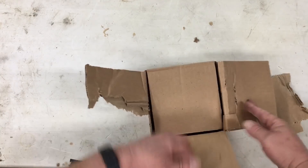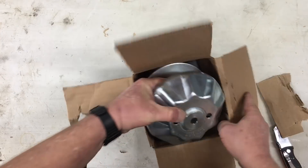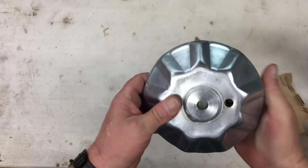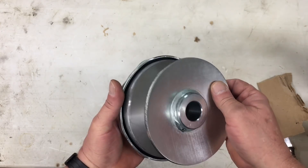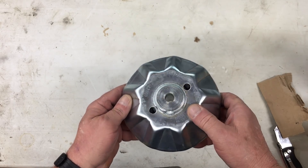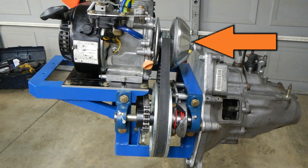That actually has me a bit confused. I'm using the torque converter as both a clutch and a torque multiplier. I feel like this is an important component in helping the car accelerate. This torque converter actually multiplies the engine torque by a factor of almost 2.5 times. This multiplication only occurs when the car is accelerating, and once the car is up to speed the converter automatically behaves like a locked-up clutch. If you're part of the anti-torque converter crowd, can you please provide a better description on why I should get rid of it? Keep in mind our street-legal go-kart weighs 1,300 lbs. Anyway, the torque converter goes here. I ended up getting a new torque converter for this build because the 420 has a 1-inch output shaft and the 212 only had a 3/4-inch shaft.